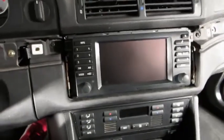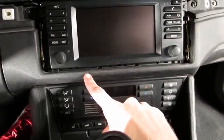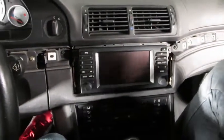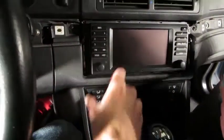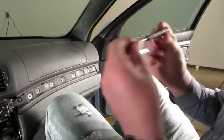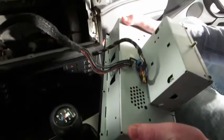The 16x9 display is held in with four PH1 Phillips screws — top left, top right, and two down at the bottom. If you have the standard MID and stock radio: when you pull the volume knob, pull it straight up. Then put a T6 Torx bit inside the volume knob hole and turn left — that will unlock the MID and you can pull it out toward you.